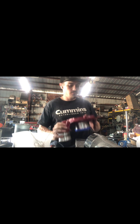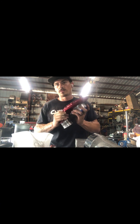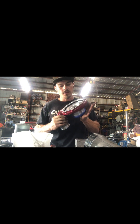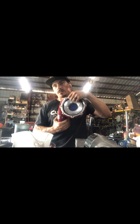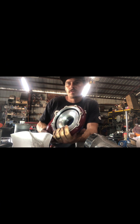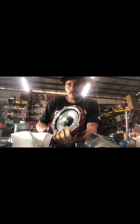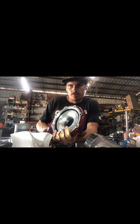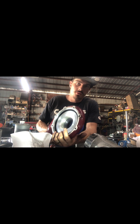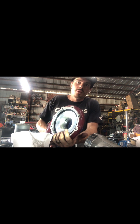Now if you're curious about the differences between an SX3 and an SXE, the main one is the compressor cover. Yes, the SXE has more fancy tidbits on the outside, but the big deal is the diffusion region. The diffusion region is the region after the compressor wheel's exducer where the airflow diffuses — we're changing it from high velocity to low velocity and from lower pressure to higher pressure.